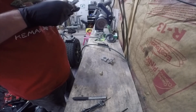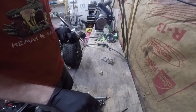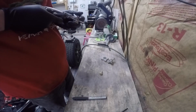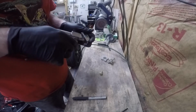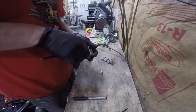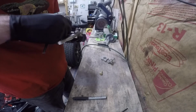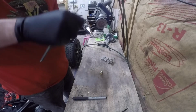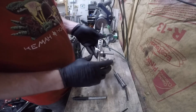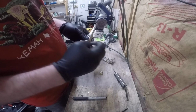This pin screw in. Is it pressed in? Set screws. See them right there. Kind of a pain to get to. So as a note to myself, when I go to put this back together, if the 3 set screws for the shaft are facing you, the pin sticks out to the right. It's got nice little grooves in it for the set screws to set in.